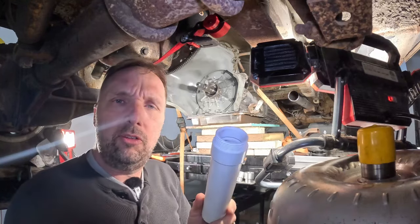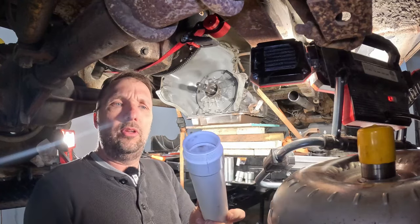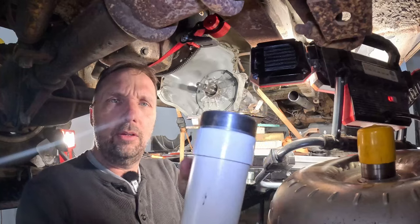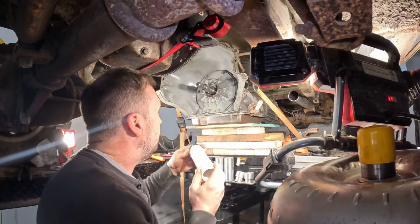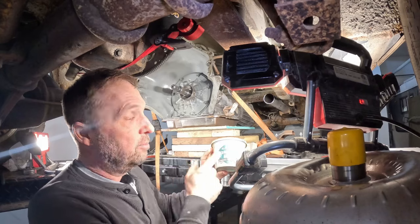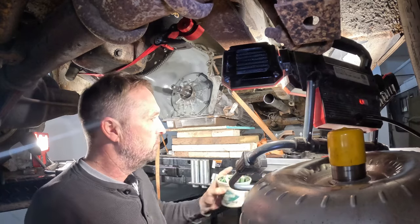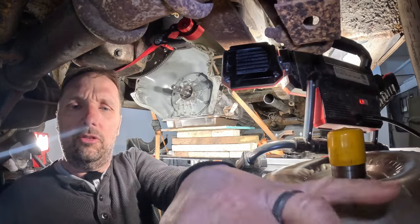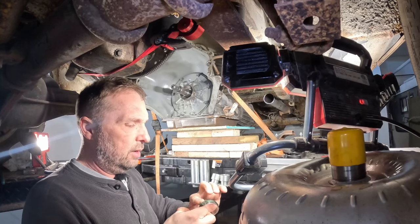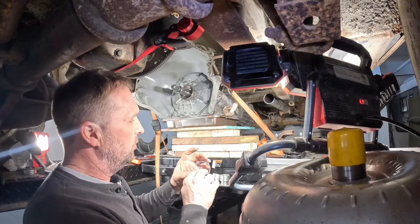This is the General Motors PVC J0912 — it's actually just a piece of PVC pipe, I think inch and a half, with a fitting that's threaded. This thing fits on there just like that, so it's going to help me get over this and put the bushing in. I've got some transmission-safe grease — you don't want to put regular axle grease in your transmission, this stuff dissolves when warm and won't harm the inner workings. We've got a little grease ring on there.